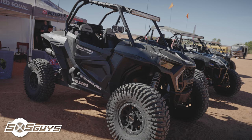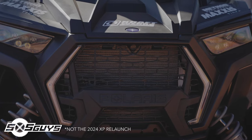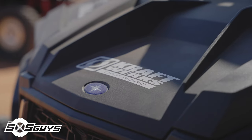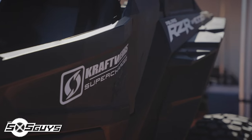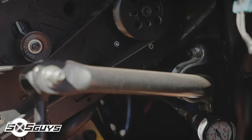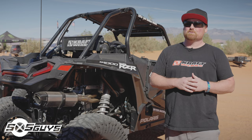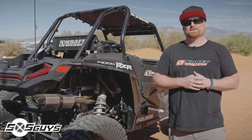We'll start off with what got us into the off-road game — this is a Polaris RZR XP 1000. Our kit covers 2014 all the way up to the new 2023. We've had this kit out for about four years with a ton of time into it and a lot of customers enjoying them. In our supercharger kits we're using a centrifugal Rotrex supercharger, spun right off the crankshaft. It's easily adaptable by moving the stator cover and bolting on our billet cover. Our base kit comes in at 7 psi and should land you right around 130-ish wheel horsepower with no motor upgrades — so it's a truly bolt-on kit.